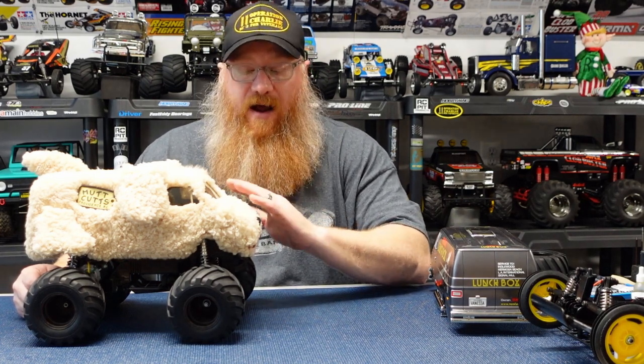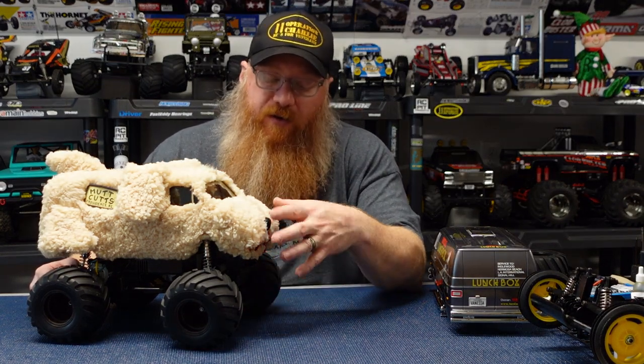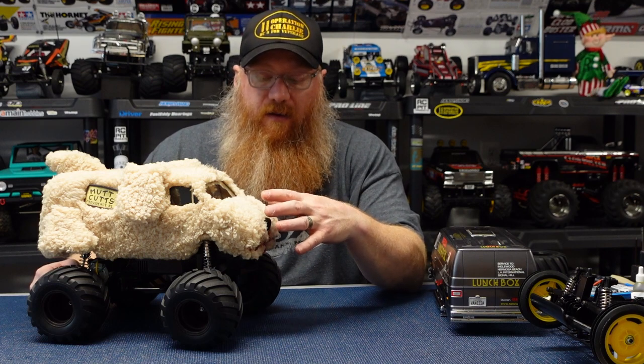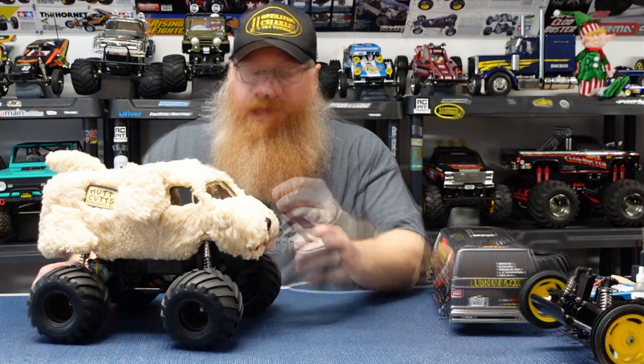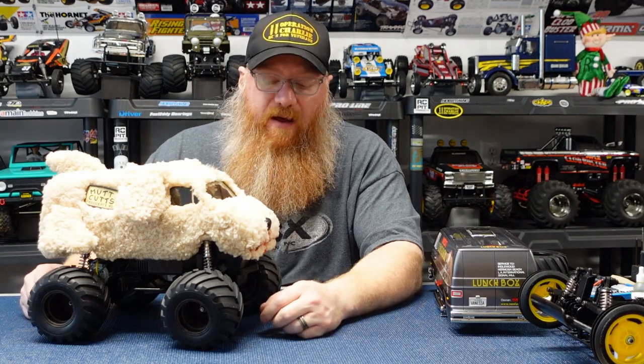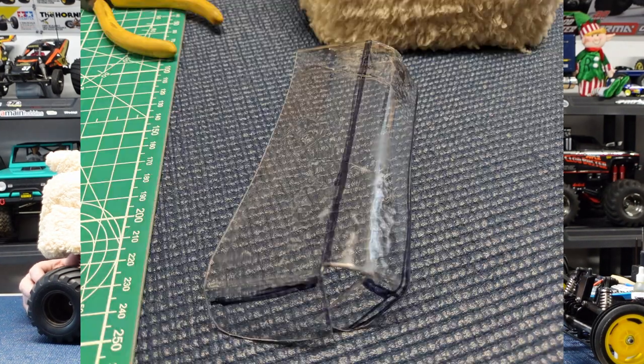I ran E6000 around the whole outside, let that dry, ran around the inside, did the same thing. That gave it a really firm, solid attachment point beside the mechanical fasteners of the screws. Once the inside was dry, I came back and feathered on another coat to give it a nice gradual slope. Once we got the basic shape done, I noticed in all the pictures online the top part of the face looks like it was added on after they covered the rest of the van with carpet. So I did that by using a really big piece of Lexan left over from a T-Max body I'd cut out years ago — almost a sixteenth of an inch thick in some spots, very heavy duty. I cut that to the general shape so it would wrap around.